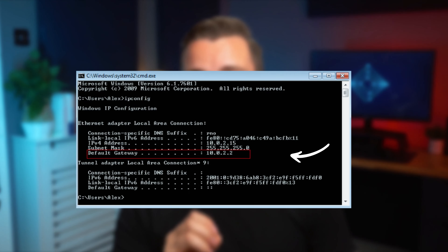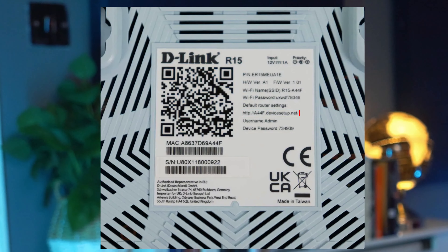Now that you have all your equipment lined up, you can start taking steps to access the router. To access the router, you'll want to look for a sticker either on the side or the bottom of the router. If the sticker is gone for some reason, go to your connection details on any computer — the connection mentions a default gateway, which is your router IP address. The sticker should hold the URL or IP address of your router and the admin password. Take the URL or IP, type it into your favourite browser, and hit enter. You should see a request for a username and password. Enter what you've found on the side of your router and you'll have access to the admin screen.